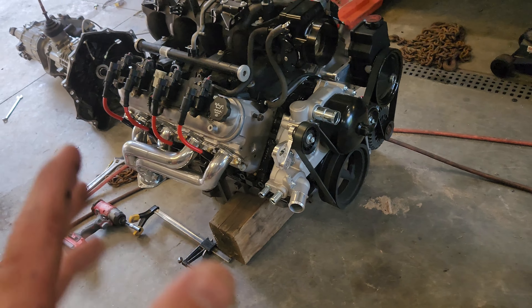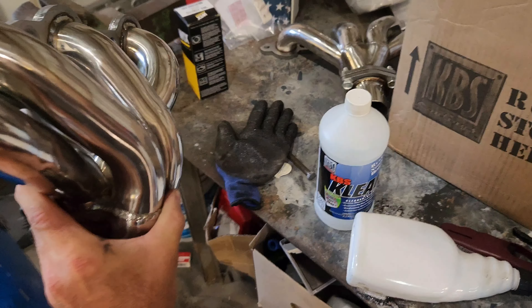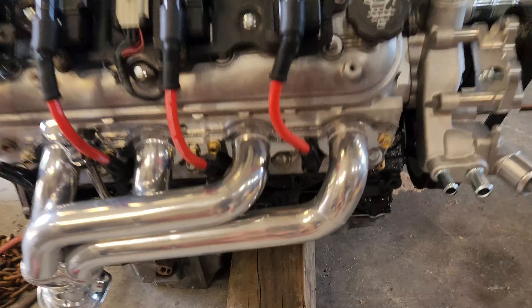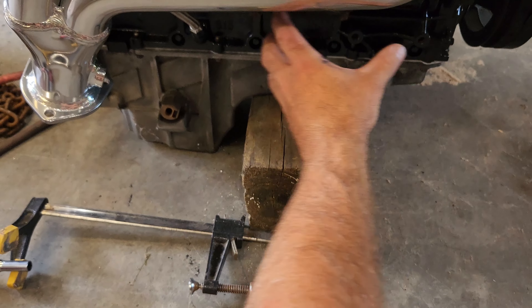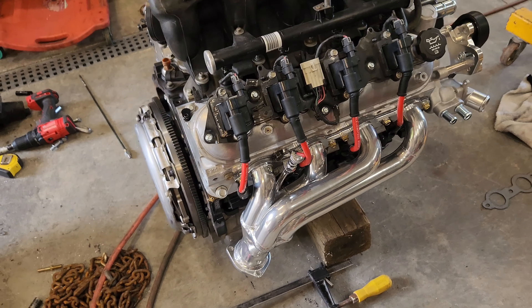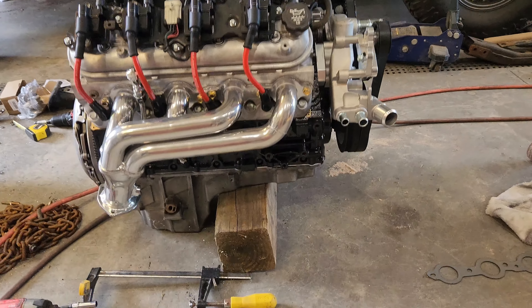I haven't actually dropped the engine in to check fitment, but going off measurements it looks like it's going to work great. I have a set of tight truck swap headers that I already used — they're very nice stainless steel and tucked very tight on the engine. However, that large rubber absorber on the mount was in the way. These Patriot headers have the outlet way back and going straight down, so you have a lot of movement and adjustment room for your mounts. Also, if you have headers that come back at an angle, they hit your firewall on a JKU swap — these dump almost straight down, which is literally perfect.